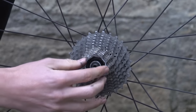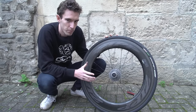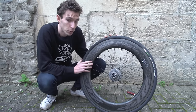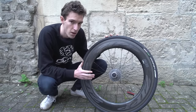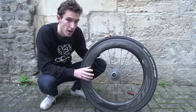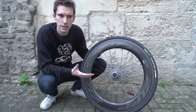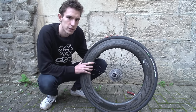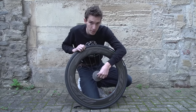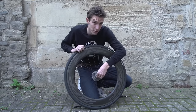As with the lock ring tool, Shimano and SRAM cassettes will only work with a Shimano and SRAM compatible freehub body, whereas Campagnolo requires a different freehub body. Although, in what is perhaps a first for the bike industry, 11-speed cassettes from Shimano and SRAM will work with Campagnolo gears, and vice versa — which I don't think has ever happened before, and it's a good thing to know. When it comes to tightening the lock ring back down, you won't actually need a chain whip this time, because you're tightening it in the direction that you pedal.